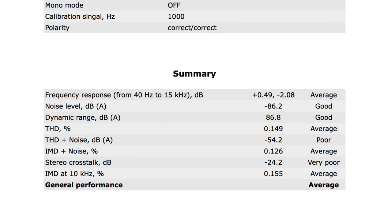Without a headphone attached, here's how the DS8 actually performs. Noise level: -86 dB — about 10 decibels off target. Dynamic range: 86 dB — also 10 decibels off. Total harmonic distortion: 0.149% — almost a thousand times off. IMD and noise: 0.126% — hundreds of multiples off. And stereo crosstalk of -24.2 dB, which is probably what a lot of people liked about it — there's basically no stereo image. You're getting such strong crossfeed that you never really get a separated channel to the left or the right.